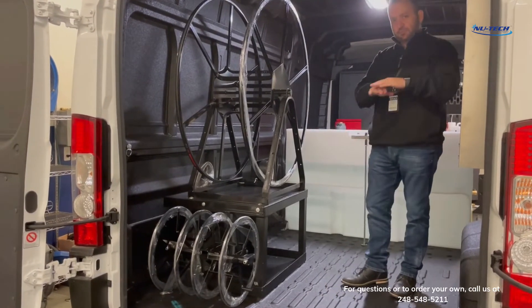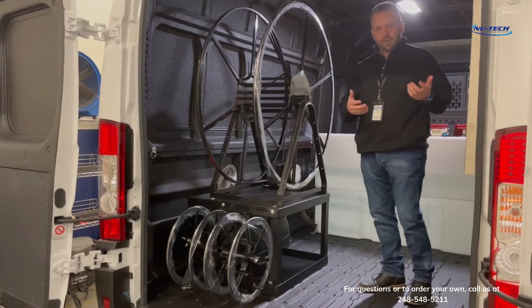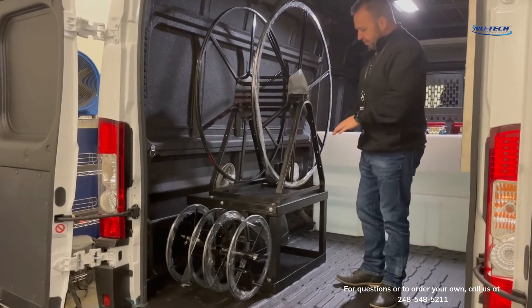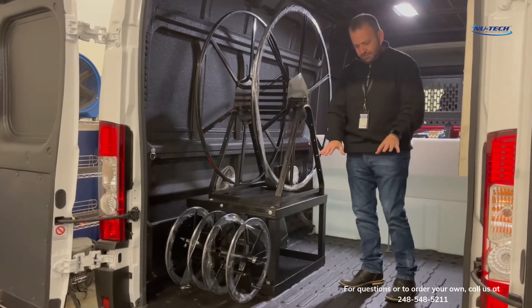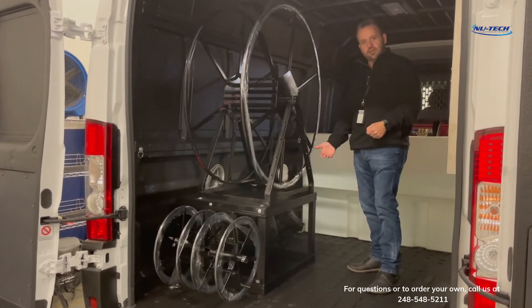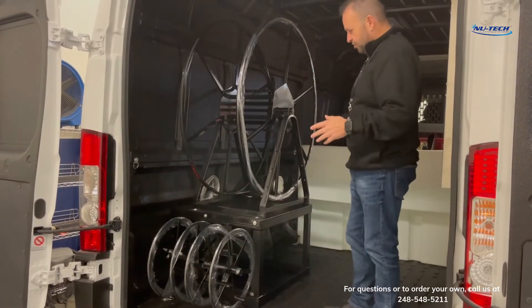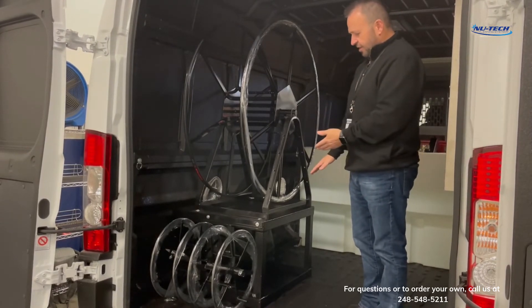Also, the stand has a complete bottom plate. A lot of people thought, oh, they're making it extra strong — yeah, it does make it extra strong, but that's not why we do it. We put a complete bottom plate on the bottom because all the van floors, as you can see like this one, are fluted. This allows any water and spills to go underneath the reel kit and just flow out of the back of the van, so you don't have trapped moisture or any of that. It also keeps what you're storing underneath there dry — it doesn't get wet from any water that might be leaking in the truck.